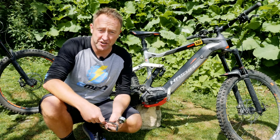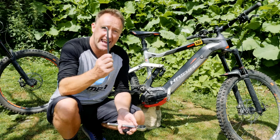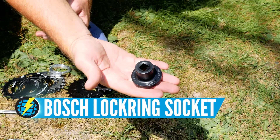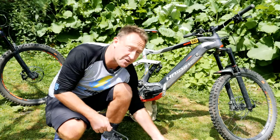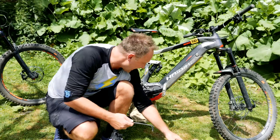Removing the front sprocket on your e-bike is super simple. You just need three tools to do this: an 8mm to remove the crank, a half-inch drive, which you add on the lock ring removing tool. The first job to do, after of course removing your battery — I can't emphasize enough how important that is — is to take the cranks off.